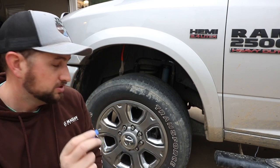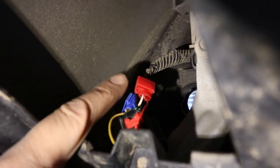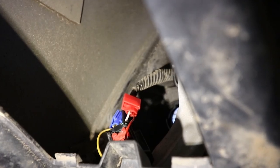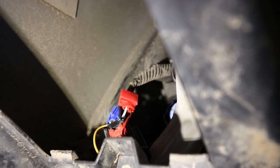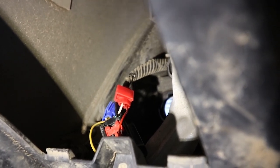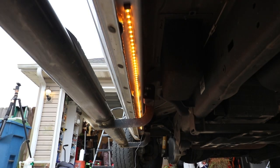These things are pretty simple to use but sometimes they don't get a great connection, so you've got to be careful. I go to the back of those two wires and use those crimps to crimp the wire in there. It definitely doesn't look pretty, but it will be tucked in behind everything and nobody will ever see it. Now we'll get the blinker installed back in the truck and check the lights — that's it working with the blinker.